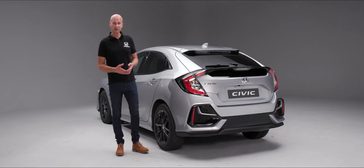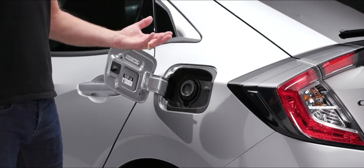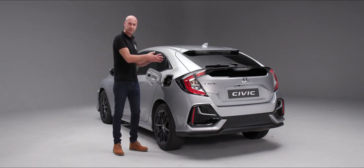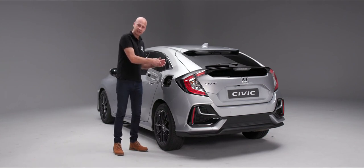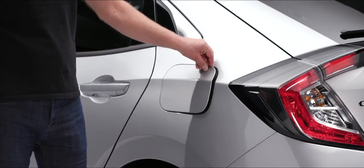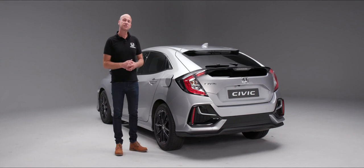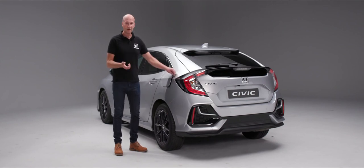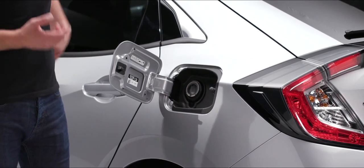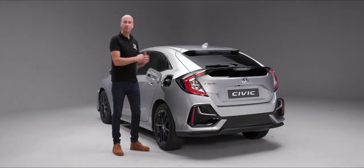With the car unlocked, push on the fuel flap to open it. The Civic has capless refueling — simply insert the pump nozzle at the petrol station and fill up. Leave it for about five seconds after clicking off the lever before removing the nozzle, then close the lid. If you ever run out of fuel, the emergency fueling nozzle found in the boot can be fitted into the capless system so you can fill up using a jerry can.